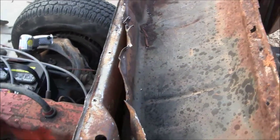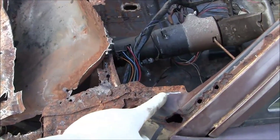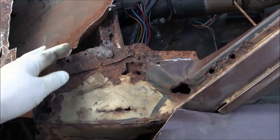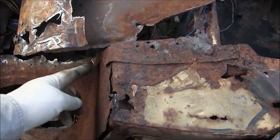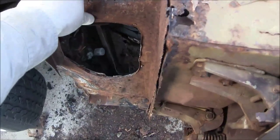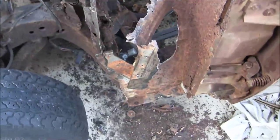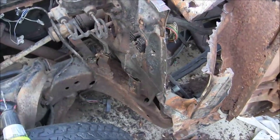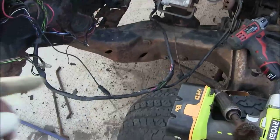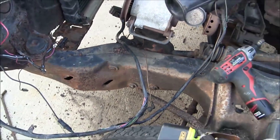Let me get you guys a better view. I still need to come in and clean the top of my pillar support, my door hinge upright, and my pillar support here. I'm going to cut all this off and clean it all the way down, then get my lower cowl panel and finish cutting it loose. Before I cut this stuff loose, I measured to make sure I didn't mess up my dimensions from the front of the car to the back. I measured from that slot right there in the frame using a tape measure.